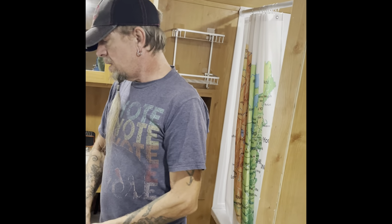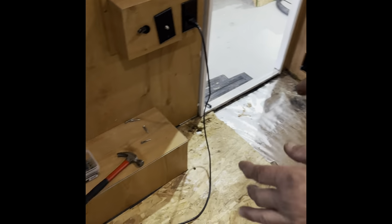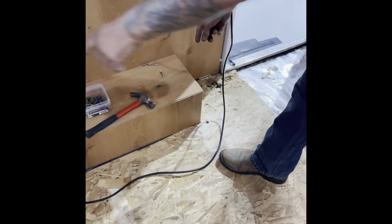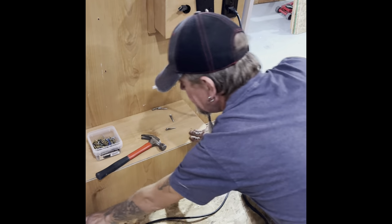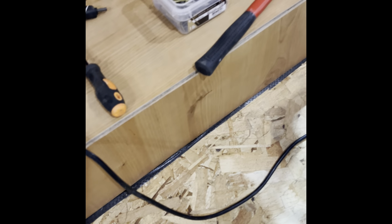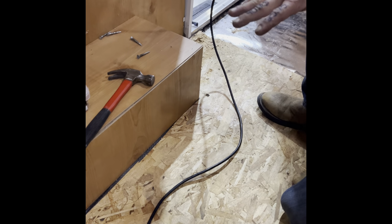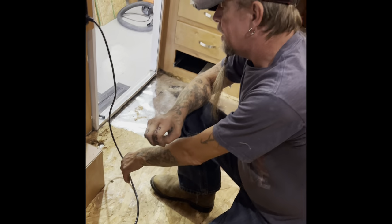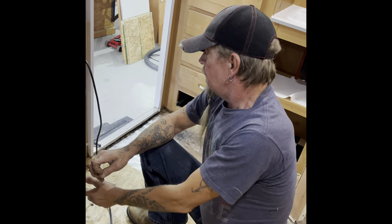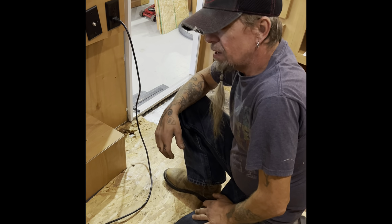What it'll take is, I'm going to take this segment right here off and disassemble all this. What it has is a metal fender well that comes in, and it's simply the way that they attached it and sealed it. You can see they use the Tyvek material right here. They think that's like a waterproofing. In some instances you might even cup that stuff and hold water in it, but whenever you put it in an application like this and stretch it over corners, it loses that integrity. I don't think it has the ability to seal the way they think it does.